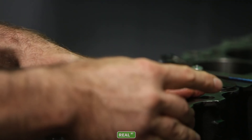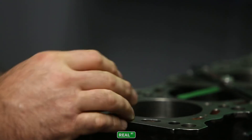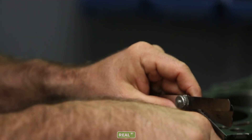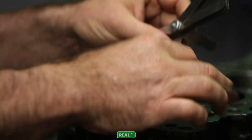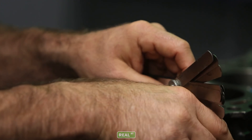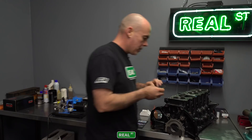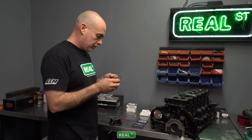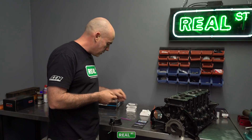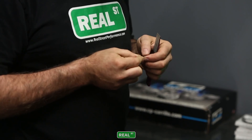If you're putting time aside to do this and you're using a small hand filer like I have, you're going to want to lay two or three hours out of your day to do this carefully. Because again, you can't put material back. So now this top ring is at its target gap. We have a little bit of an edge that we're going to just use this file and clean up a little bit to where it's smooth.